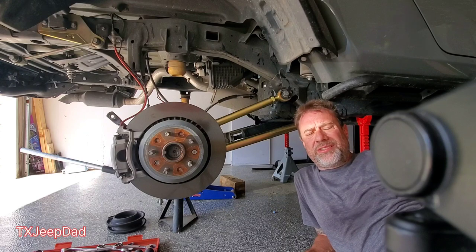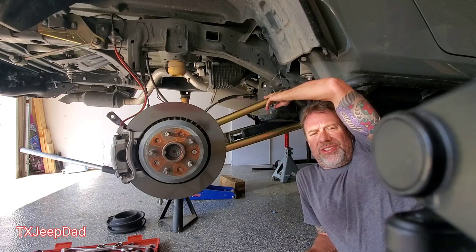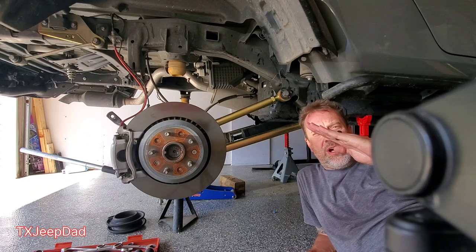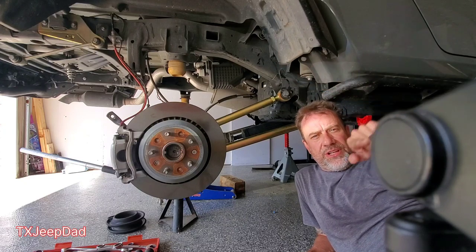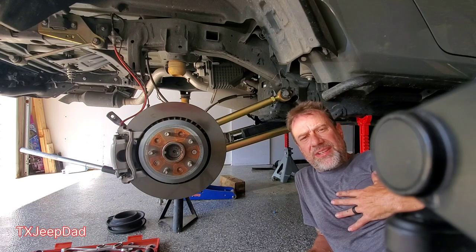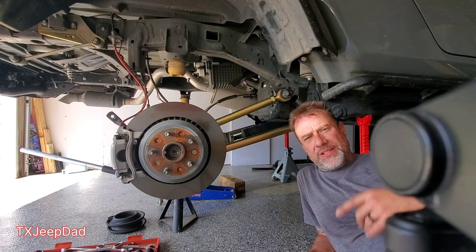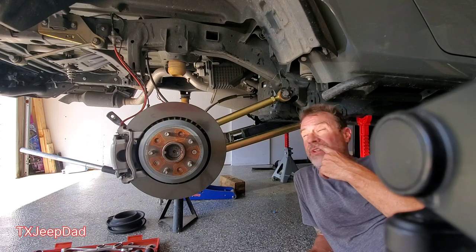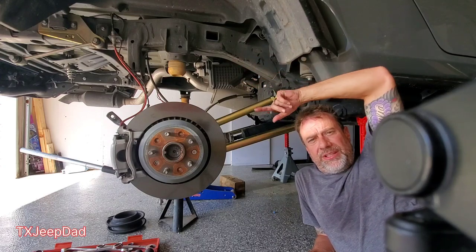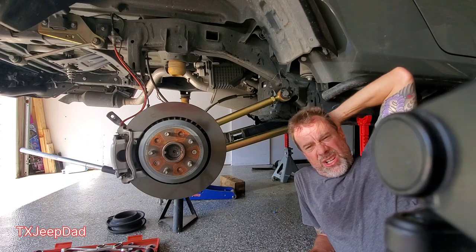Doing the rears is not that hard if you ever have to adjust the links. My pinion angle is definitely coming down — it was way too high before, and I had some problems with my springs. I'm doing it myself; I can do it myself twice as cheap as paying somebody to do it once. Control arms are in, now I'm going to shimmy the springs in, then I've got the shocks and the track bar to measure.